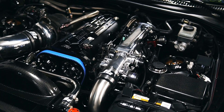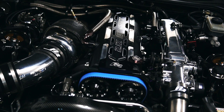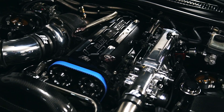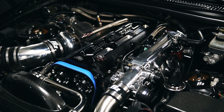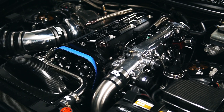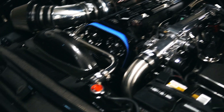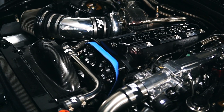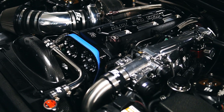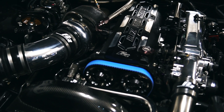You don't need anything really crazy on these cars to pull out a bunch of power. The drivetrain — this is an original six-speed car — so really all you need to do is upgrade the clutch, which just has the RPS twin carbon clutch and that's been holding up really nice. Other than that, you swap the turbo, upgrade the fuel, go bigger intercooler, and that's essentially all you need — with proper fuel like E85 or some type of raised octane gas to be able to raise the boost up enough to get the power level you want. Overall very happy with this car; these Supras are just so awesome.